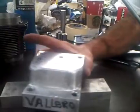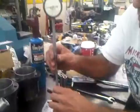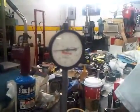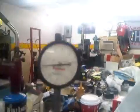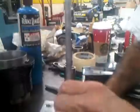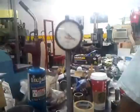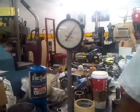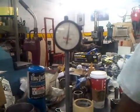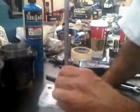Now we're going to set it on a flat plate, so we have zero clearance between the tool and the plate. We expect to get about 40 thousandths deck out of this measurement, so we're going to preload the dial to 50 for ease of measuring.